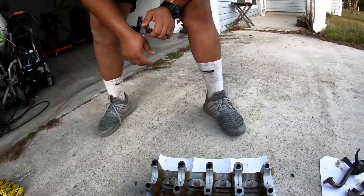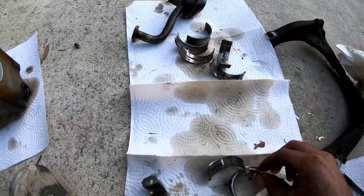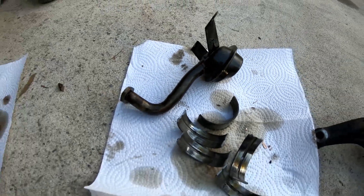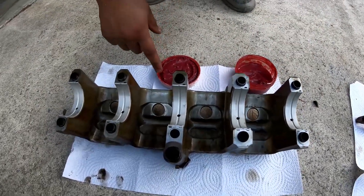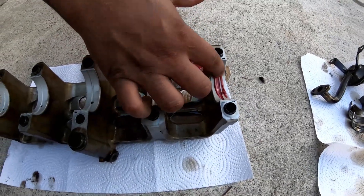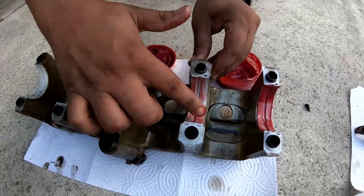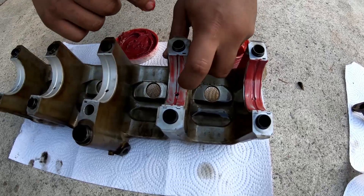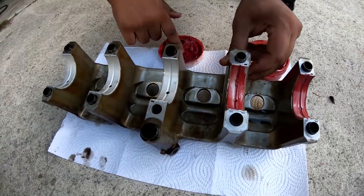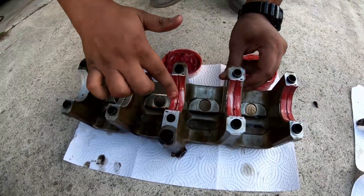Go get the assembly lube. You don't need much because there's still oil everywhere inside — you're just giving it some initial friction loss. So we're going to send it with half the mains being replaced — the lower halves — with that one rod bearing. Just going to send it — sloppy mechanic style. Sloppy mechanics can be applied to more than just domestics.